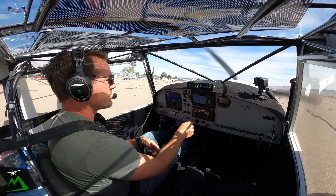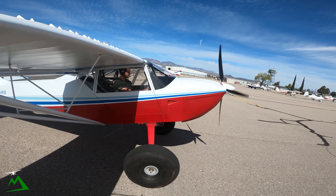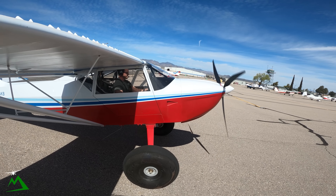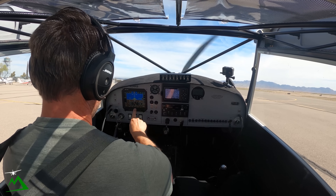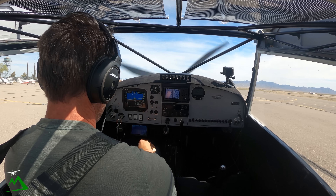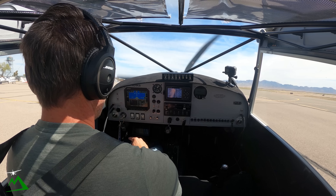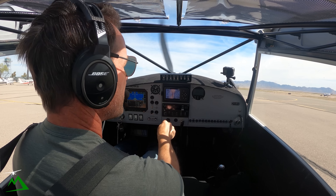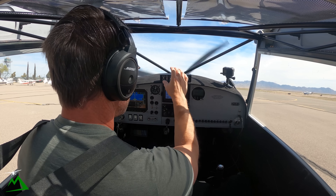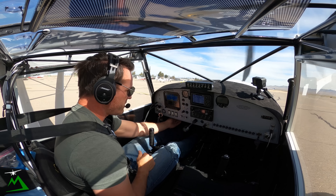Already up to temperature. And if you guys can see, my fuel gauge isn't bouncing around like it used to, because I did put a little resistor back there. We're warmed up. Let's go up to 4,000 RPM, check our ignition. That's good. We'll do an idle check and make sure that we are still charging without landing light. I'm just sitting here at idle, which I am still over 12V. If I turn everything else off, like strobes and everything like that, at idle — we are good.